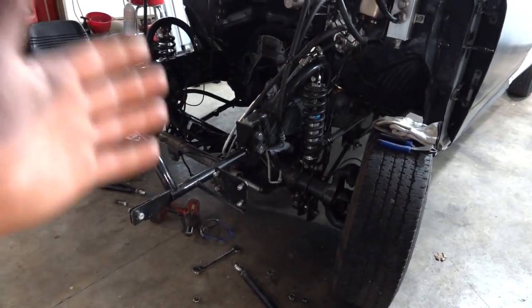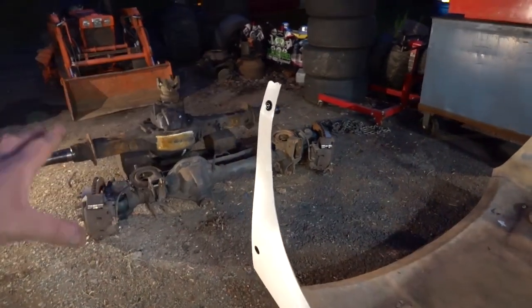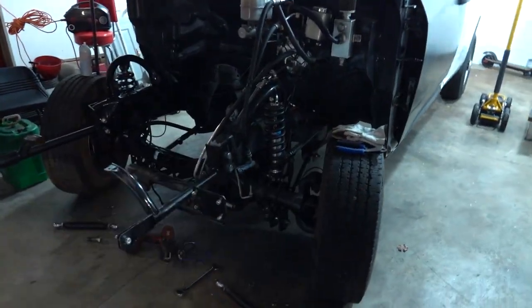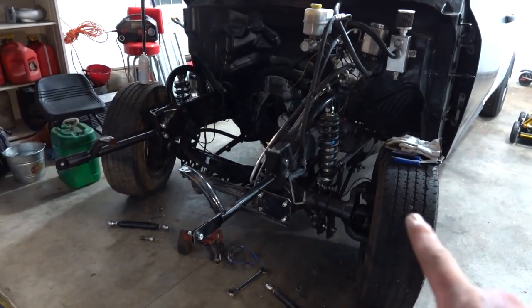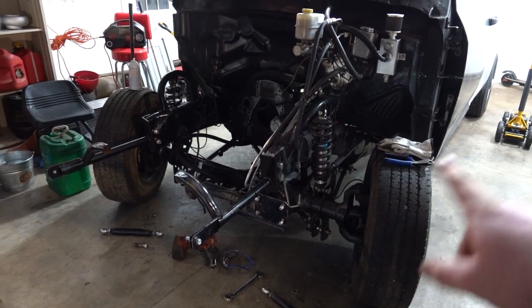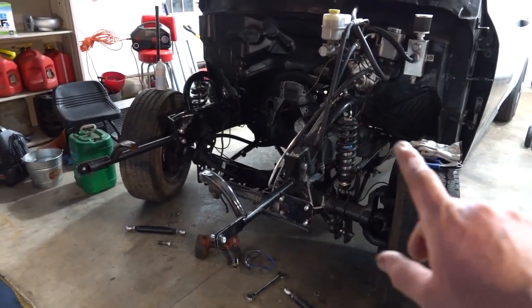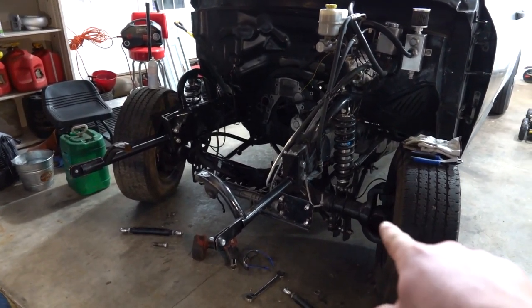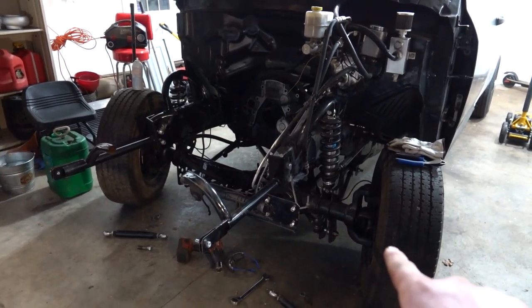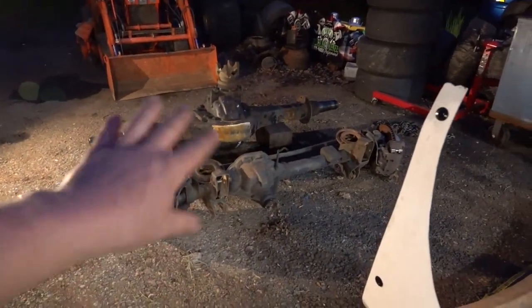I don't think that drag racing we're going to have an issue with the stock axle shafts in this truck, but all that being said, the fourth gen front rears, at least the 2010 to 12 trucks, and I want to say it goes to 13 and then they got into some axle disconnect stuff, I'm not 100% sure on all the years, these actually have a 1550 U-joint, so it has bigger U-joints than you can get in a third gen. So this is definitely the sled pulling setup. I believe this is 1450 U-joints, something like that.